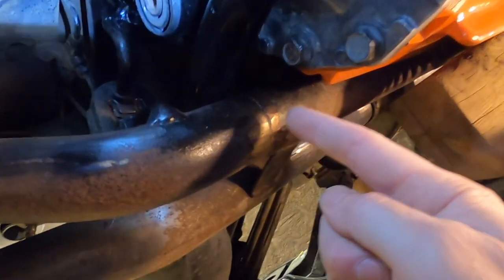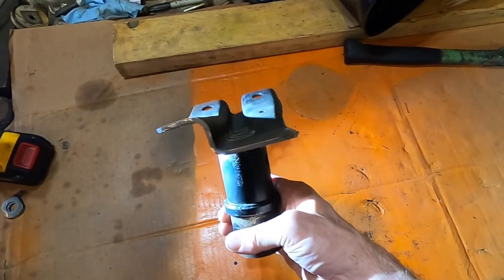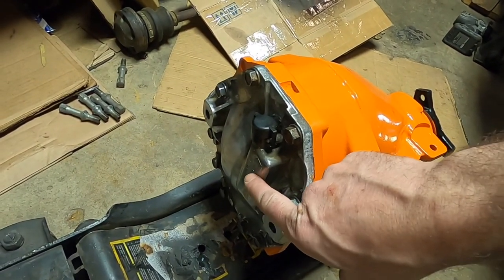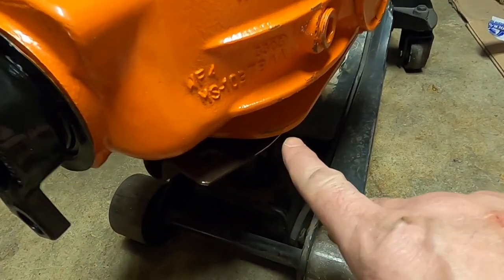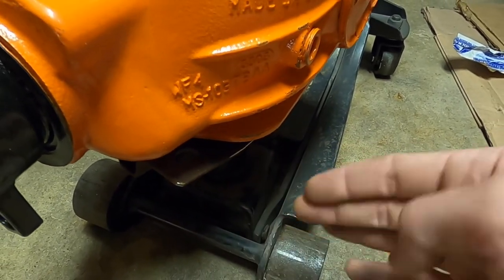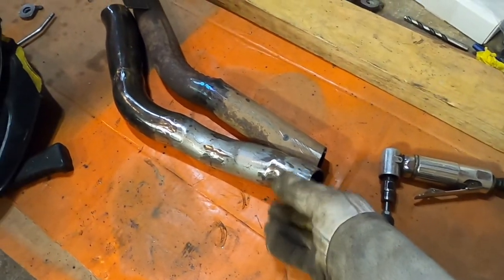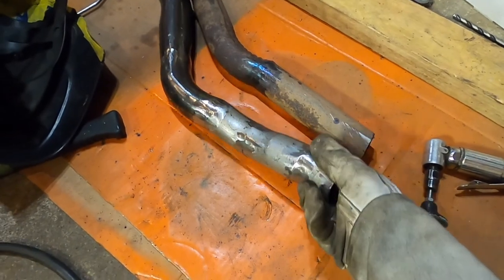Also, my exhaust pipe is too close. Here is my patent-pending differential holder — and there it is, free from the car. This is basically what's causing the interference — you can see how that sticks out, and you can see that rub mark and the paint on that fin. The exhaust is contacting right there just on the corner, so I'm going to move that exhaust over. I was able to make a replacement piece of pipe that has just a bit more extreme bend, and it actually dips a bit more — you'll see that when it's in the car.